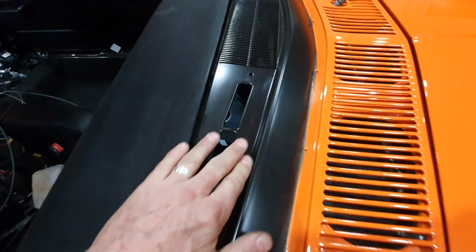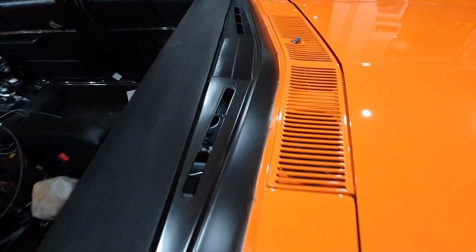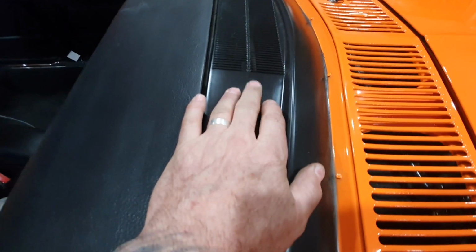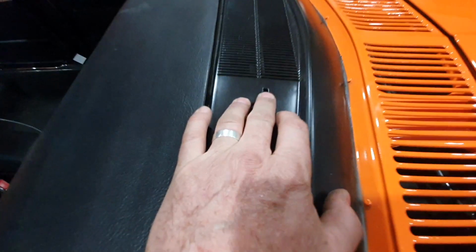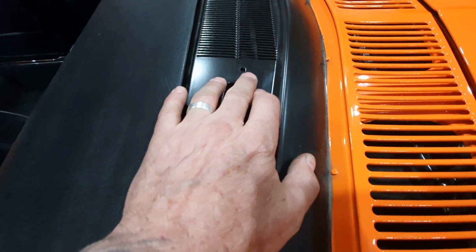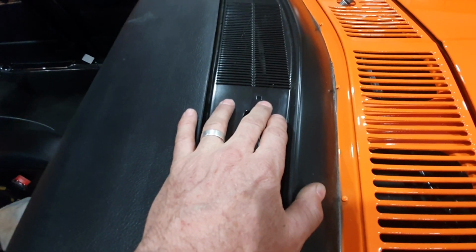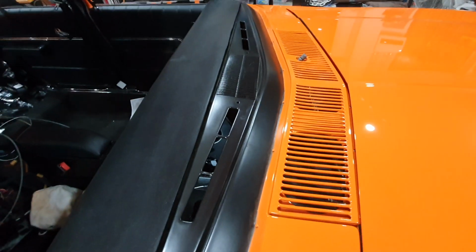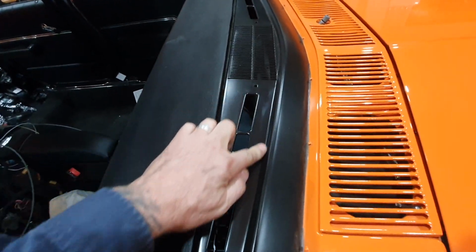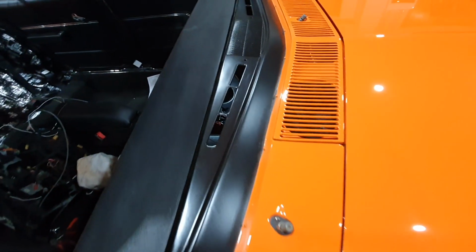If you want to see a rip-off in car parts, try and find original bolts for those holes there. Some people are asking $60 for those two little bolts. It's bloody daylight robbery. So what I'm going to do is go to the bolt store. You'll be able to find a coach bolt that has that square head under it. I'll just polish the dome nice and smooth. They're really small bolts of that size anyway. I'll then prime them and paint them black in the same satin black that's on this dash, and you'll just see a nice little dome head on top of there. So that's what I'll do.